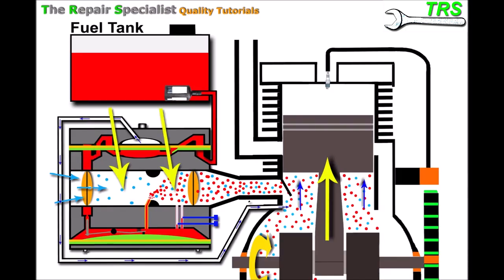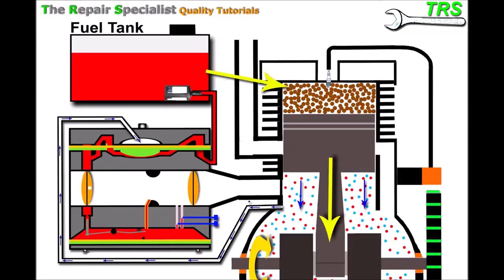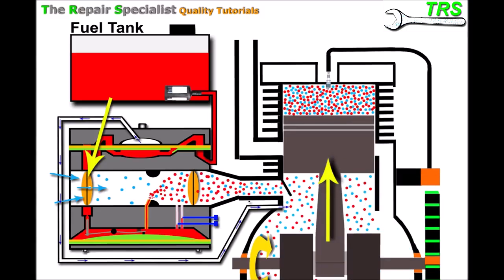Because of that restricted airflow, a vacuum builds up inside, sucking fuel out of that jet quite heavily, so there's more fuel than air in the ratio. The engine will run for several cycles like this on choke until it warms up. Once warm, we remove the choke. We then get a higher influx of air and because there's less restriction from the butterfly, we get less vacuum pulling fuel out, giving a higher air-to-fuel ratio — a better mix for a warm engine to run on.